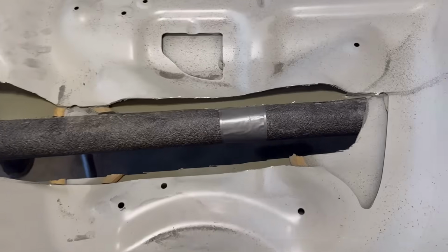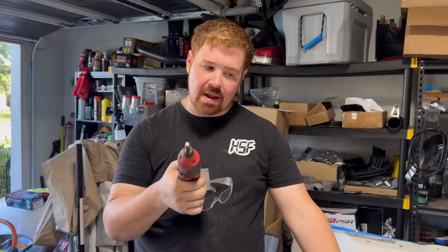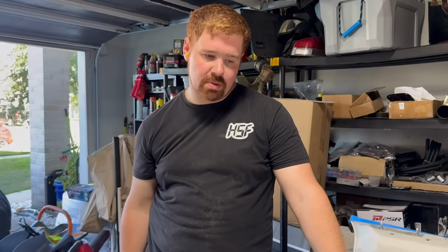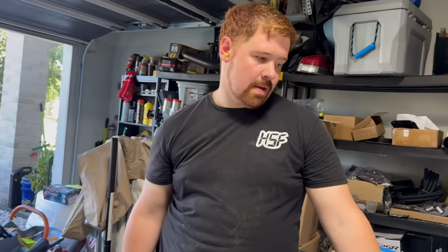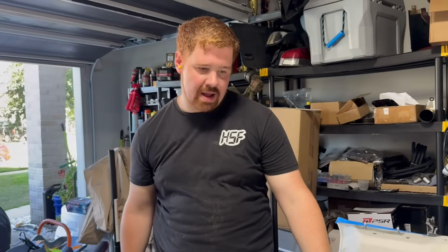The beautiful part about this hood, it's aluminum, so we don't have to worry about it rusting or anything of that nature. But again, at the very least, I want to go through with a little sander bit, and we're going to clean up all the burrs and whatnot, so we don't get any stragglers, whatever it may be. And then we're going to blow the hood off real good, and we'll bring it back in here to drill some holes to put the hood vents in.